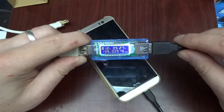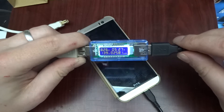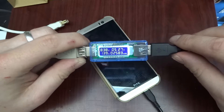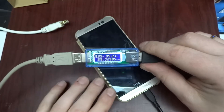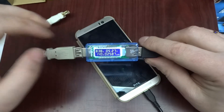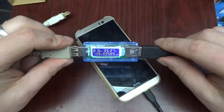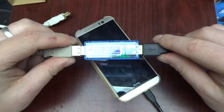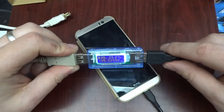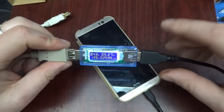So you've got roughly eleven to twelve watts of power going in versus seven and a half — that's your 30 to 40 percent faster charging. What's happening is the phone, provided it supports the fast charging method, communicates with the charger via the USB cable and tells the charger how much power it needs and that it can handle it. This can charge the phone up to 70 percent in under half an hour or so.